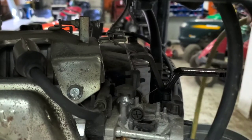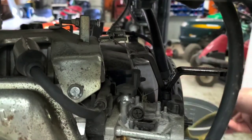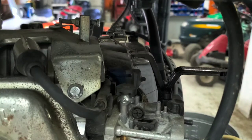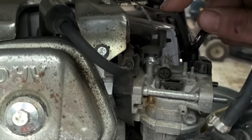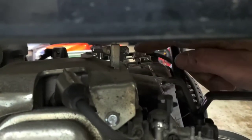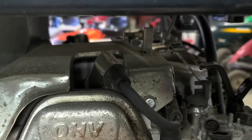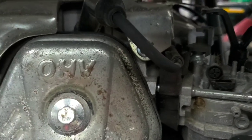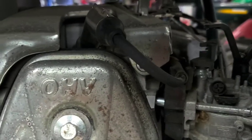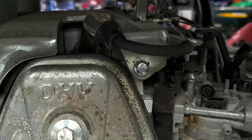Get the rest of the carburetor here, taking off the linkage and all that. Hook up the fuel line and turn the fuel on to try to get as much old fuel out as we can by draining it. Afterwards we'll go through and blow it all out to make sure it's 100% clear of that bad fuel. You can see the choke up top — it's connected over here. Sometimes the gasket at the bottom will be holding that carb on pretty tight. If you just take something and wedge it in between, it'll pull it off.